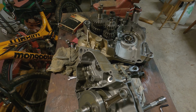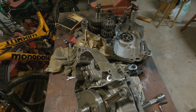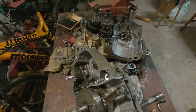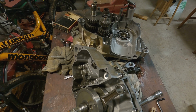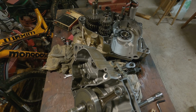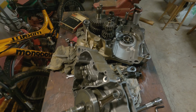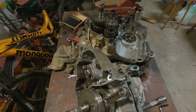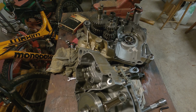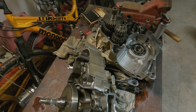Let's see, what is that? They have them from 76.95 to 77.01. What is that, 5 steps? So that's pretty neat. And I think this stock one is the 76.96 millimeter, which is the stock size.